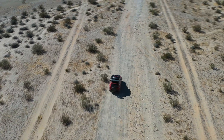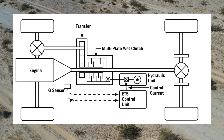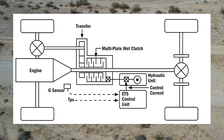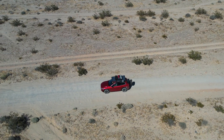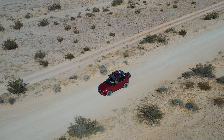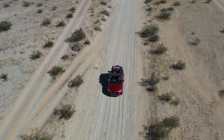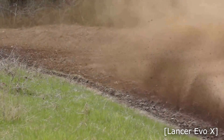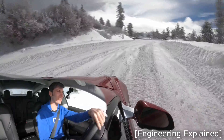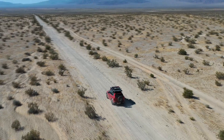So, not simply just a variable limited slip center differential. Many vehicles have clutch packs which allow you to control up to a 50-50 torque split, essentially going from not locked at all to 100% locked. But to really send torque to either axle depending on how much traction is there, essentially no vehicle could do that except for high-end crazy rally cars and electric vehicles that have independent motors in the front and rear axles. So there's the potential here to get amazing performance out of this e-all-wheel drive system.